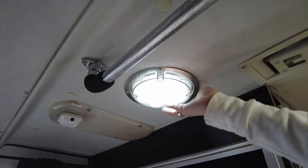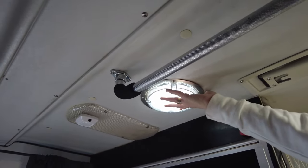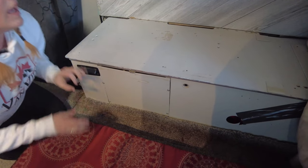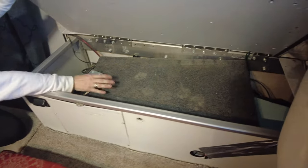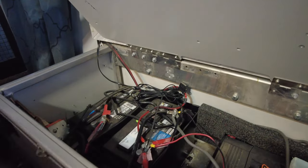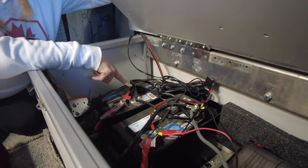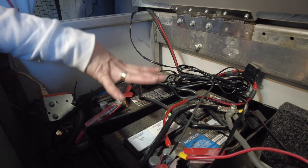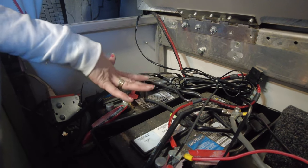This is actually running off the cab, but there's a little switch right here that turns it off and on. I can't leave them on or they're going to drain the front battery. So here's one of my little cushions, my couch that I built. And in here is my power system. These are my two batteries and they are only 80 amp hours, and you can only go down to 50%, so I only have a total of 80 usable amp hours.